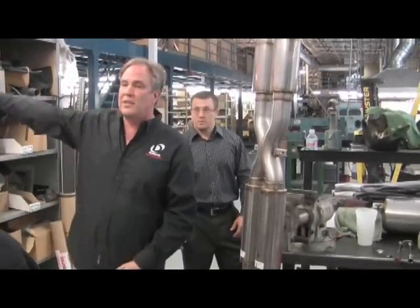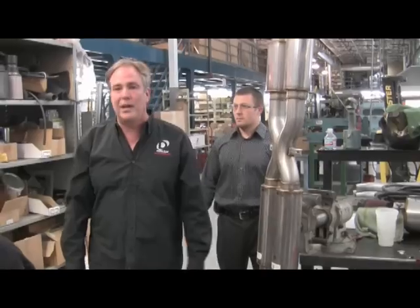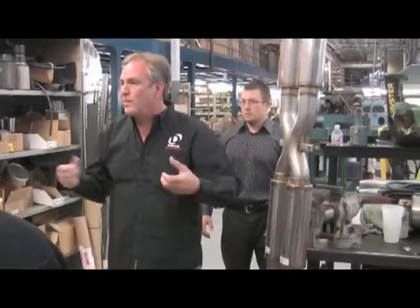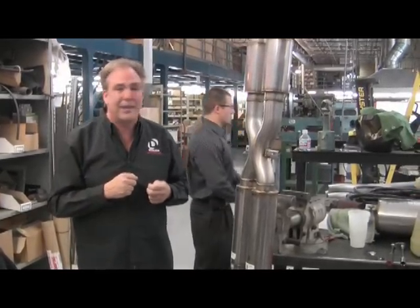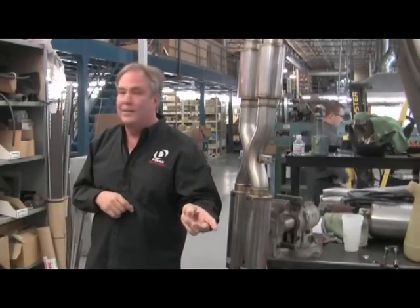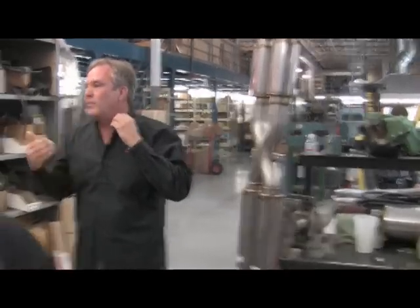So for example, if you look at the E60 M5 cold air intake out there, that's a $2,000 cold air intake from us. Everybody else's is $600 to $800. But it's 2 injection-molded air boxes with rubber hose to seal the front of the car, with carbon fiber lids with bigger air mass meters. The tooling for the plastic was $100,000 to make the boxes, $100,000. Our cost to build that kit is more than the other people's retail price, with the amount of parts inside. But it is sealed. It is an insulated plastic material. It actually makes more power. It doesn't make less.